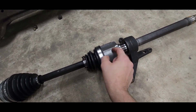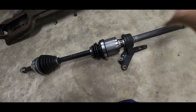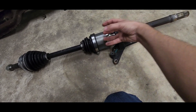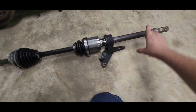The bearings all have C-clips that sit around them and hold them to the little bearing pack. Once you pull the boot back and pull the cup off, there's a C-clip at the top. There are splines on the end of the shaft that the bearings slide onto with a little C-clip at the top. You just pry that clip apart, pull it off, and then the bearings will just slide right off the shaft.